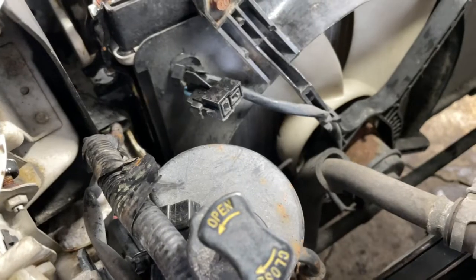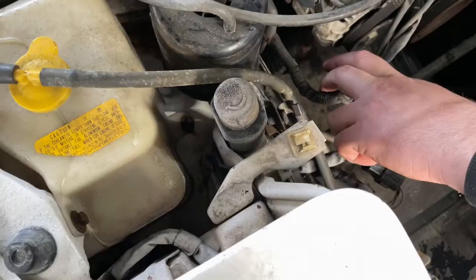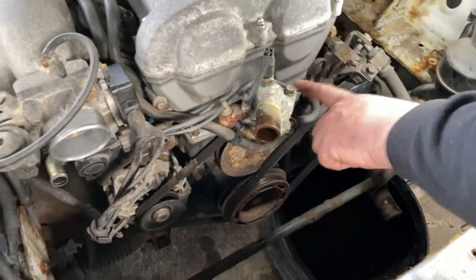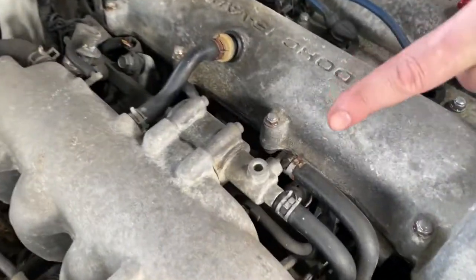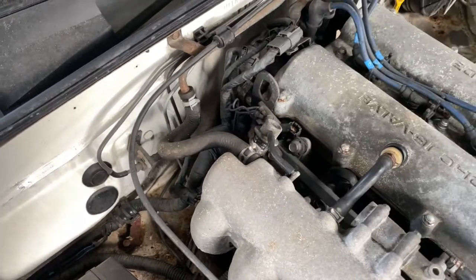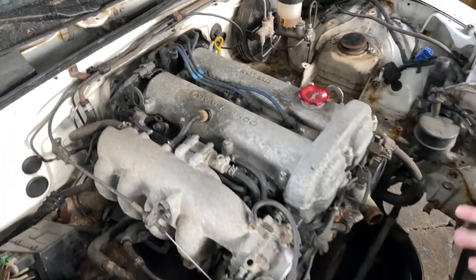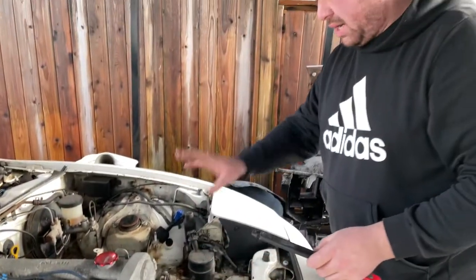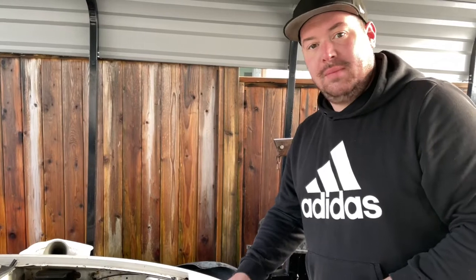There are going to be two wiring harnesses. This one controls the idle air control, there's a coolant temp sensor, and then the power steering pressure sensor on this side. The other wiring harness is the injector and ignition harness on the back side of the engine — it runs to the fuel injectors, the coil pack, your cam angle sensor, those kind of items. We'll get the front wiring harness out of the way and then start pulling some accessories. We'll leave the alternator on the engine, but the power steering pump we're going to take off and leave to the side.